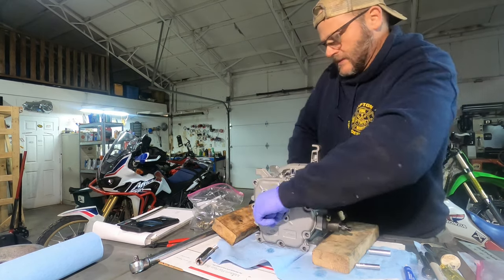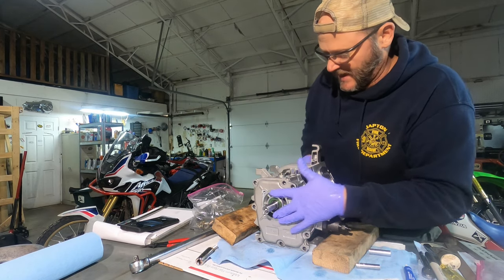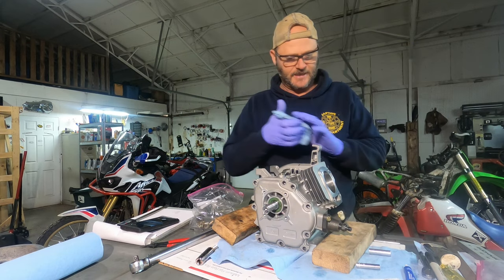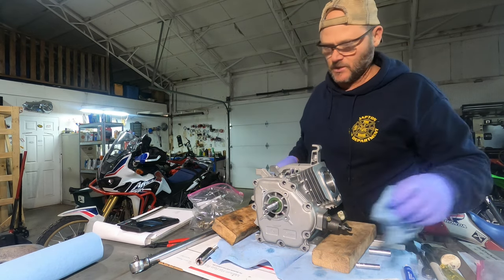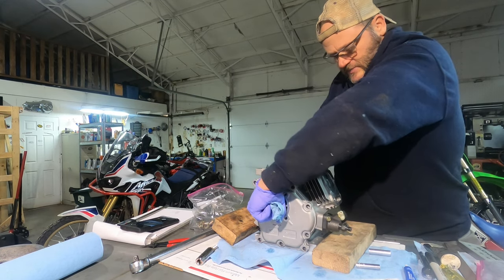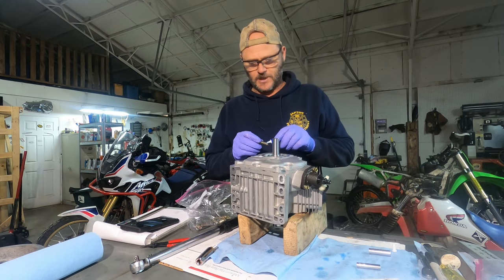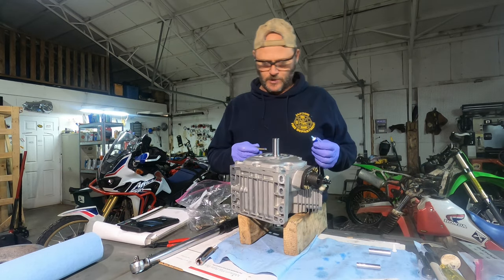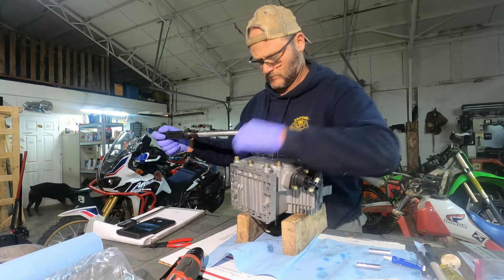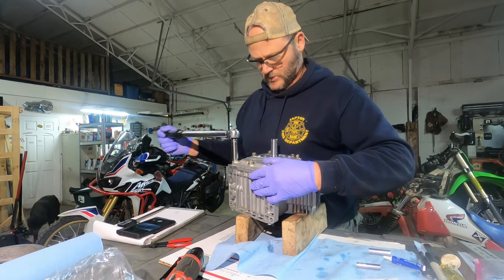If it doesn't, I'm going to press it in. I laid this a little bit flatter so I could turn the crankshaft real easy. As I was turning the crankshaft, the gears aligned inside there from the governor — that plastic governor gear. Now I'm going to put this back to top dead center. Now we're going to bolt on this plate. You want to use a crisscross pattern — just going to 10 foot-pounds this first time. Crisscross pattern.